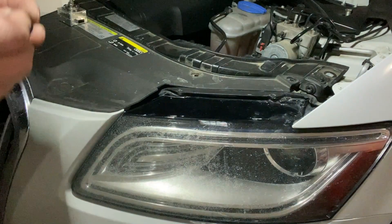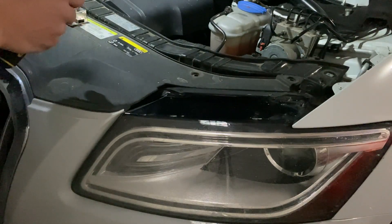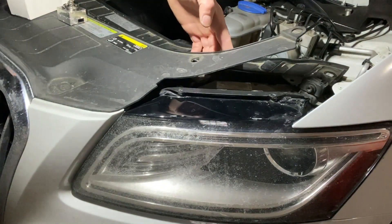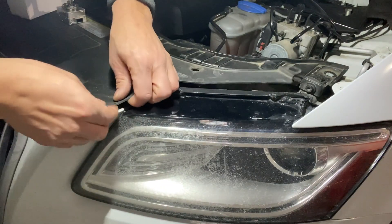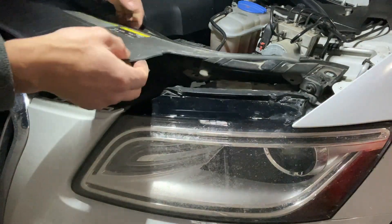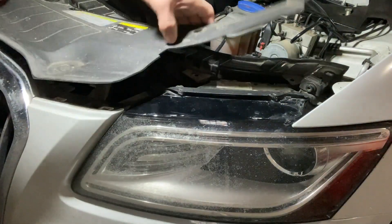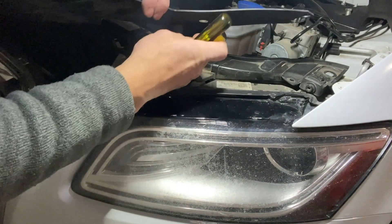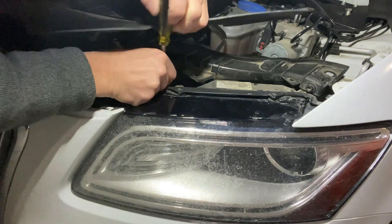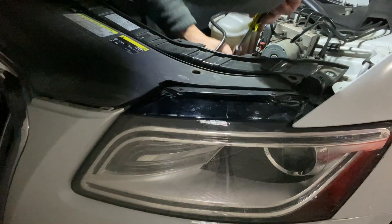You see that one popped out - as long as it's out, it's better than in. You can lift that flap and it will very gently just pop off. You can literally lift it - the fourth screw is right here. You don't have to lift it completely, just enough to have access. Screw it out, don't lose it. That's two out of four - let's remove the further back one.